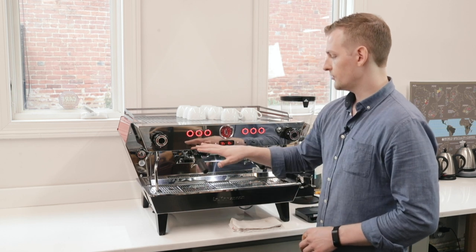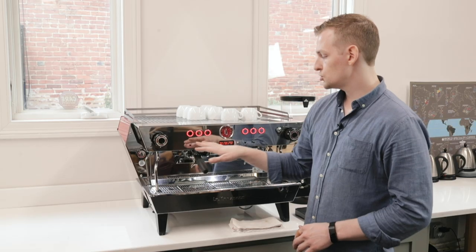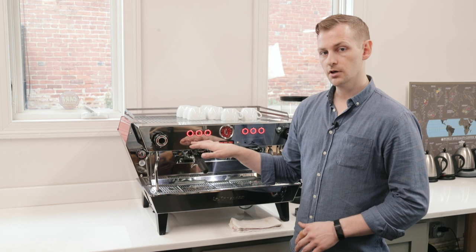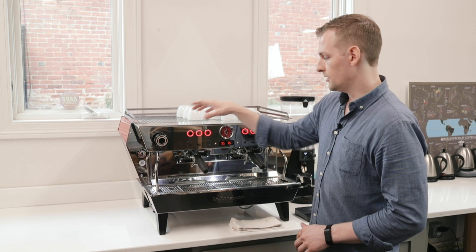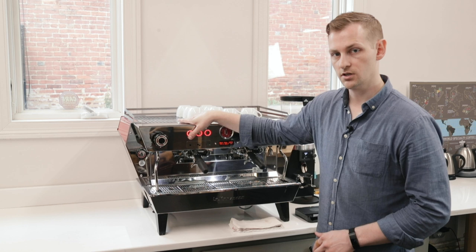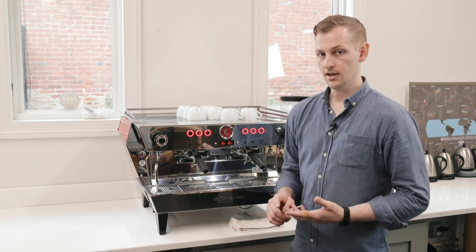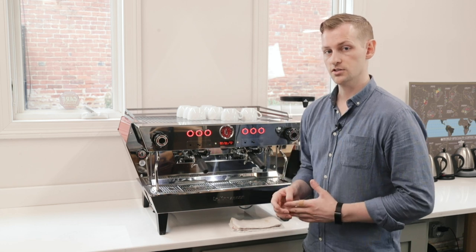You'll notice these linear PB-style buttons above each group. There are two dosing buttons plus a continuous or semi-auto dosing button. The two programmable dosing buttons both have short press and long press capabilities — pressing the button once gives you one programmed dose, and holding the button for about two seconds gives you another programmed dose. Both of those functions are available for mass mode and volumetric mode. In brew ratio mode there's a slightly different functionality.